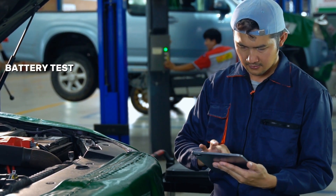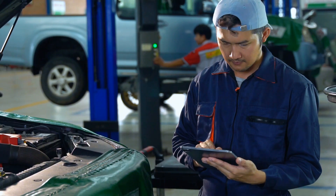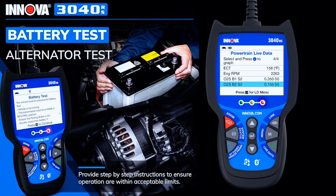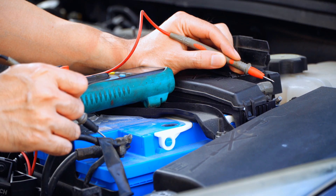The Innova 3040RS engine diagnostic code reader tool ensures your vehicle is programmed correctly to accept a new battery. It does so by checking if the batteries and alternators are in line with voltage specs recommended for the vehicle. When troubleshooting a no-start or hard start condition, carrying out this test really helps in knowing where to look, hence saving time.